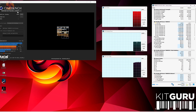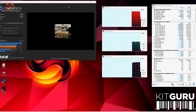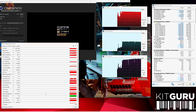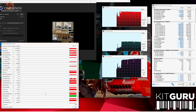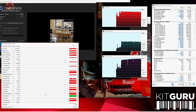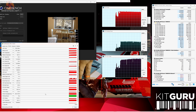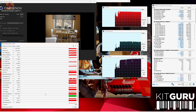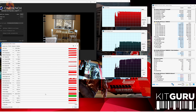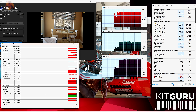In the Cinebench run, the Be Quiet CPU cooler has no difficulty controlling the AMD processor; however, the graphics card is idle so system power draw is very low at this point. Adding the GPU makes a huge difference. Running a combination of Cinebench R23 and the Speedway stress test, the CPU draws 150 watts, the graphics card pulls 560 watts, and total system power draw is 890 watts at the wall socket. CPU temperature is above 90°C but it is not throttling — everything is fine, and it would be easy to set a thermal limit in PBO.